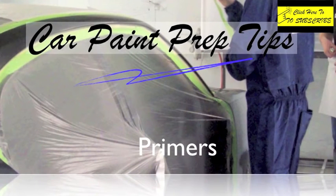Now we're going to start talking about primers, and there's different primers for different things that you're going to be doing. For example, for corrosion protection, for bare metal, you want a certain primer. Whenever you're filling scratches or body work, you want a certain primer. And then for color hiding, for covering what's underneath, you want a primer sealer. So I've got a little chart. We'll talk a little bit more about that.